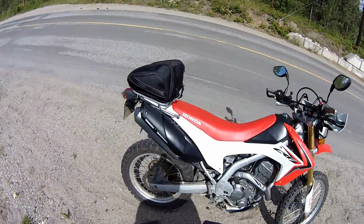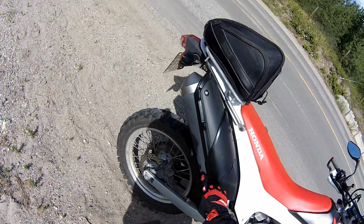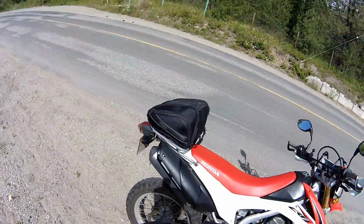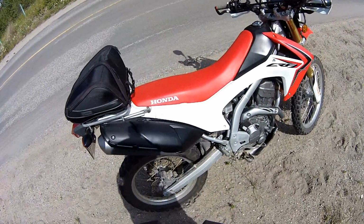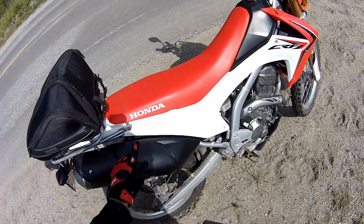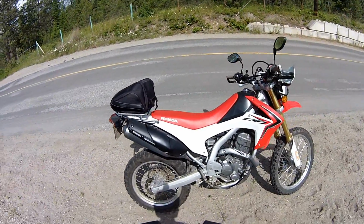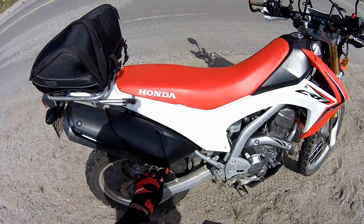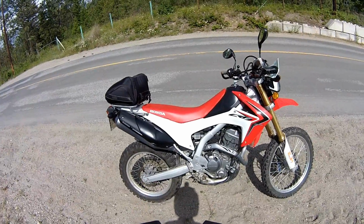The only damage to the bike was right here, these exhaust covers. They all broke in half. There's actually 3 pieces, 1, 2, 3. That one and that one broke in half. And so Honda wants $200 for that whole assembly. So what I did was I joined them right there and around there on the lower one with fiberglass cloth and 2-part epoxy glue. And that worked nice. It's very strong. This portion ground away. I could have just built it up with a bit of putty, but I didn't bother. And then I painted it black so it wouldn't be such a standout.